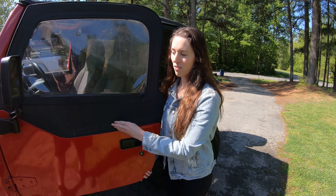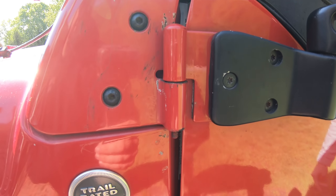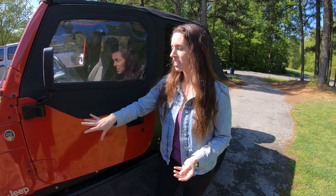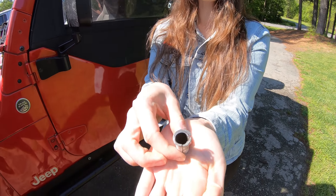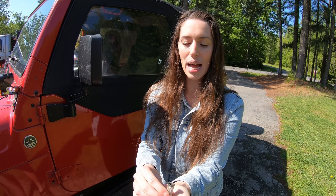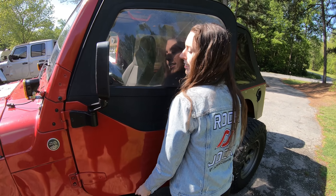This leads into number two. One thing I didn't notice until I had these half doors on is all of the play in the door hinge liners — both the upper and the lower. Because of this, the door does not line up exactly; it makes it really hard to close. That's because the factory door hinge liners are made out of metal — it's a metal-on-metal design. They corrode over time and deform.